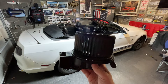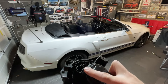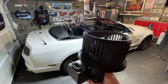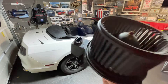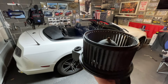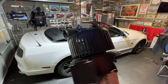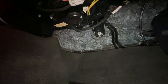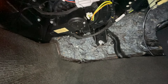This is a really easy replacement to do. It's got one electrical connector and three 8mm screws that go around the outside of it. You can only put these in one way - the little hole at the end, this little bit here, slots straight in underneath the passenger glove box. You can't really make a mistake with it. I'll leave the link to the part in the description below - it's a RockAuto part and it's a five minute job.